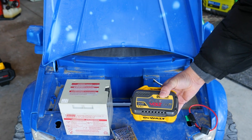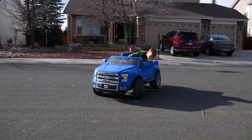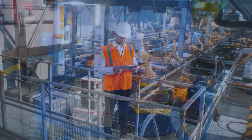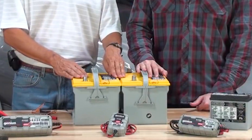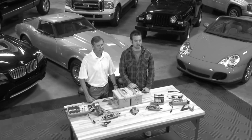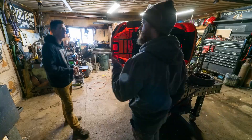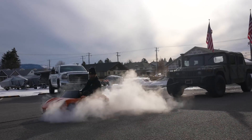There's also the custom battery conversion route. If you've ever wondered about supercharging Power Wheels with a custom battery conversion, it's like giving your ride a turbo boost, but with a few caveats. Converting your standard lead-acid battery to a lithium one is possible, but it's not manufacturer-approved. You'd typically use two 5,400 mAh lithium batteries meant for RC cars. By running them in parallel, you can unlock the power potential, extending the range and possibly the battery's life. But it's a big but — this isn't an official mod. It's a custom upgrade and not for the faint of heart. You're venturing into uncharted territory, and it may void any existing warranties. Safety is paramount — a mistake could zap your fun, literally.